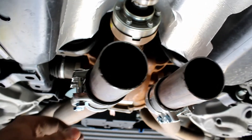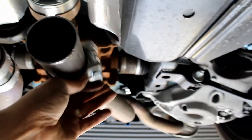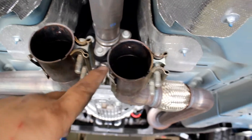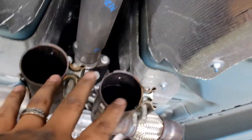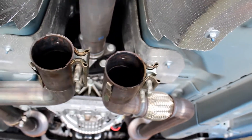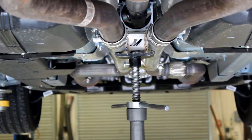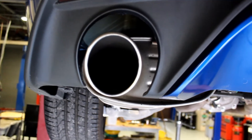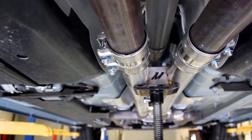Once you clean all this up and make sure it's all straight, I'm putting the bolts on the outside on both sides, also facing down. For these big silver clamps that come with the kit, I already reseated these clamps on those nipples on the side. Now I'm gonna slide the H-pipe from the back in, support the H-pipe oriented by the logo, so you can lift and lower it to get the exhaust tip to look centered.